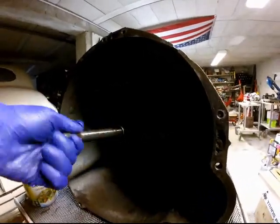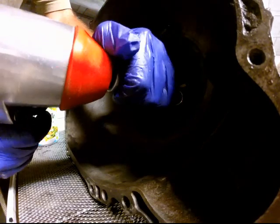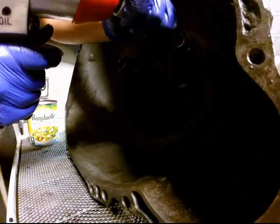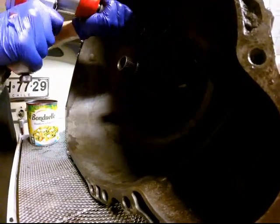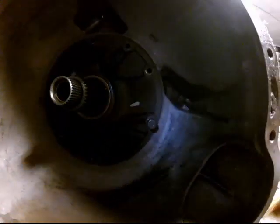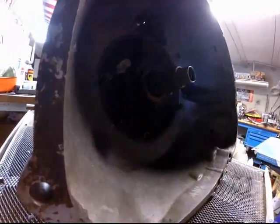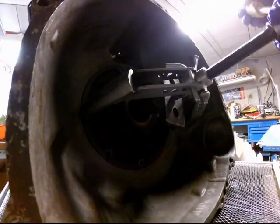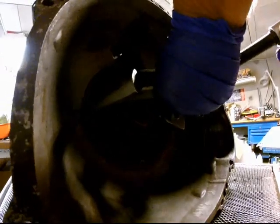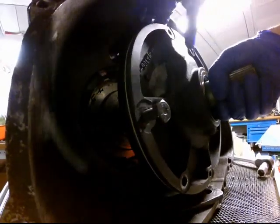At the front of the tranny, remove the direct shaft. Then remove the 7 bolts retaining the front pump. Two holes of the front pump are threaded, so you can use a slide hammer or an extractor to extract the front pump. I use an extractor and carefully extract the front pump.